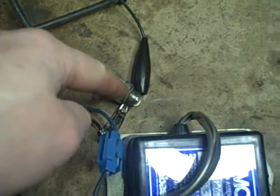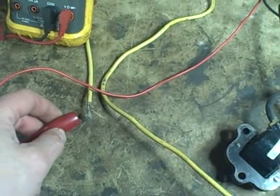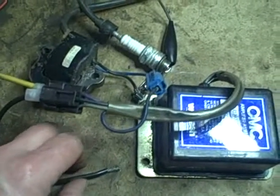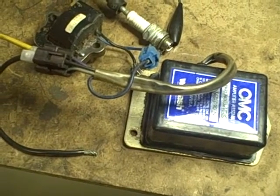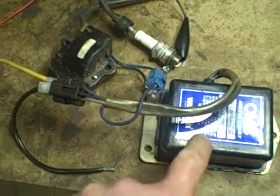Here's my test setup. I've got a spark plug attached as my spark gap. I've got the blue wire reconnected, my ground wire grounded to the case with a screw, and my ground lead going back to my 12-volt power supply. This is going to be my 12 volts, and this is my trigger. All I need to do to trigger it is touch it to ground and simulate points making and breaking. I believe the way this circuit works is unlike conventional points-condenser breaker ignitions, where when the points open that causes the capacitor to discharge and fire. In this case, when the points close, that's the trigger — it's the opposite.